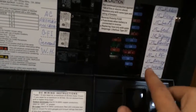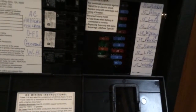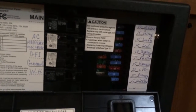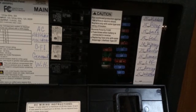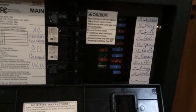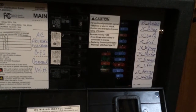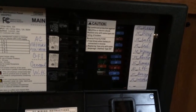Just replace it with the same rated fuse. If you pull a 15, put a 15 in. If you pull a 10, put a 10 in. If it looks like somebody's been in there putting in fuses that aren't supposed to be there, you can always check your owner's manual to make sure it's actually rated for 15. You don't want to put a 20 or 25 amp fuse in just because it's the only thing you have. The reason there are ratings is because sometimes the wire does not support more than 10 amps. If it's wired for a maximum of 10 amps and you put a 20 amp fuse in, and a direct short occurs, that wire can actually melt and start a fire before it reaches 20 amps — because it's not rated to carry that amperage load.